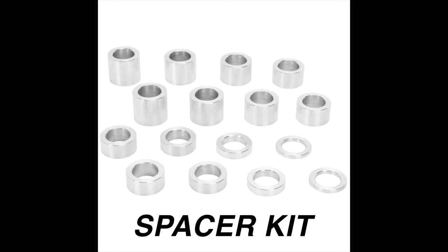Spacer kits are sold on every motorcycle parts website imaginable — pick one from your favorite company. The only thing that matters is that it be the correct diameter to slip over your axle; they're essentially just pieces of aluminum with a hole through them. On the opposite side of your wheel, you are going to use your brake caliper as the spacer. The exception to this is if you have a really wide hardtail and a really narrow wheel — you might actually need to use your brake caliper plus a small extra spacer. On my particular bike I used a stock rear wheel and did not need to use an extra spacer with the brake caliper. In fact, my caliper was actually a little bit too big and I needed to mill it down.